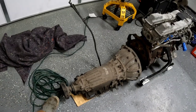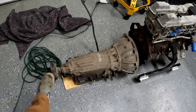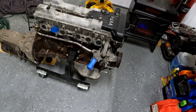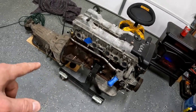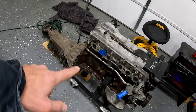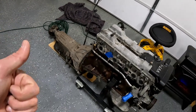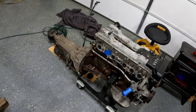What's really cool about this is that only the Supra and the Aristo use these flex discs, and the Merc uses the exact same flex disc. So to put this in the car is unbelievably simple. If you want to be really cheap about it, since the Toyota and the Merc basically have the same dimension engine — the M103 is a straight six as well — you can actually just bolt this into the Merc by drilling two new holes and notching the transmission mount. There is a guy on eBay that sells the conversion mounts for a couple hundred bucks, but this almost was designed to go into that Mercedes — it fits so well. The only thing you really have to do is shorten the drive shaft about two inches, and then you have to fuel it, cool it, and build a new exhaust. But as far as swaps go, this is super easy.